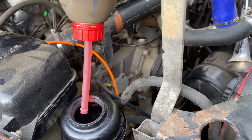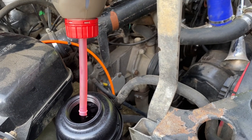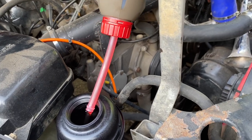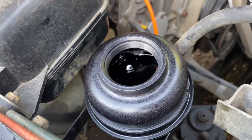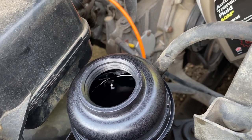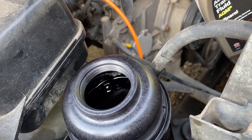It's going to take about a litre to fill up if all your pipes are empty and you've got your new pump on and the reservoir. I'm just going to fill it up a little bit here — you can see all the air running out of it as it runs down the pipework. Give it a minute to settle and fill it back up again, then we'll get the engine started and start bleeding it through the bleed nipple.